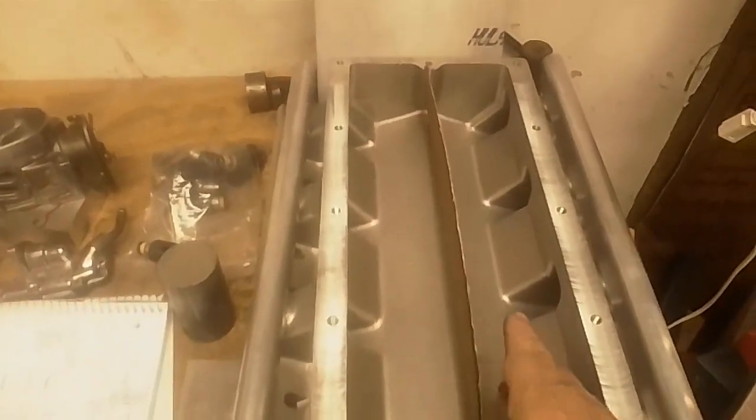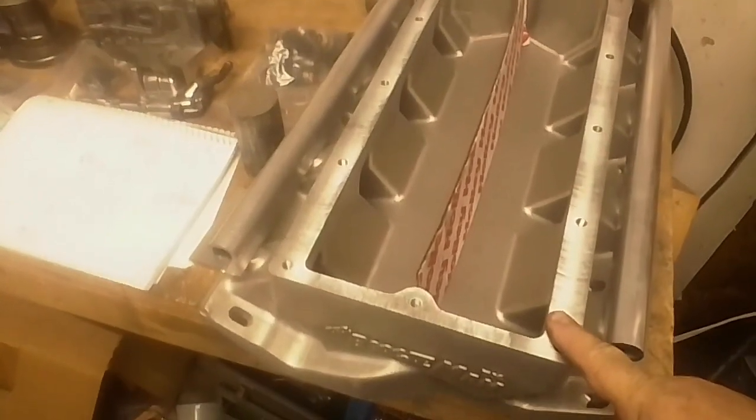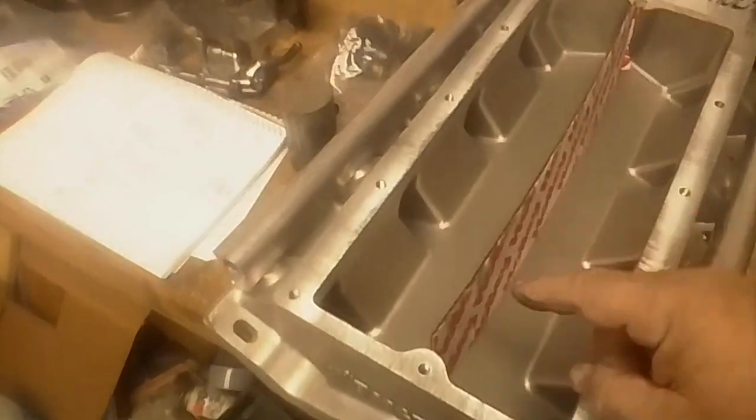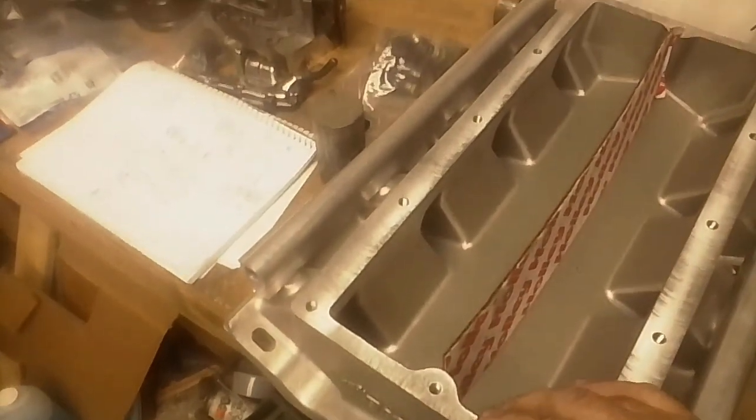And then the inside is going to have a divider plate just like I did on the carburetors. So I will probably put a divider. Now technically it should have a taper to it. When you're coming in at the end of an intake like this, sometimes you can run into trouble at this port, and I may just try a straight one and see because it's easier to make, but I will make it to where if I have to put a slight taper and machine one, I can do that so that it pushes the velocity up.